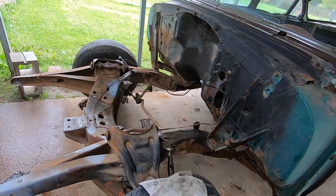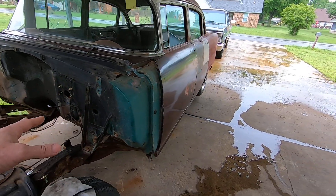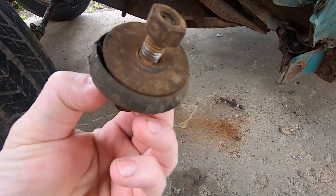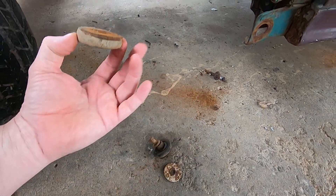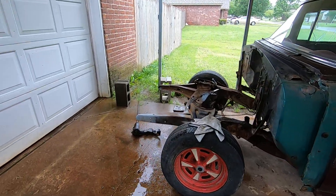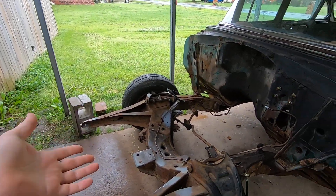After I adjusted it, I removed the steering box — it has the shaft coming out so you pretty much have to take it off to get the body off. I started taking all the body mount bolts out. This is what original body mounts look like over time — one side's really squished, the other side's kind of fat, they're pretty much wasted. Fortunately I have a new set of Energy Suspension urethane body mounts to put back on it. I was actually missing two body mounts but a subscriber, William, stepped up and sent me two of them, so now I have a full set.